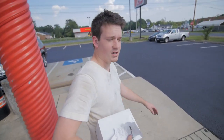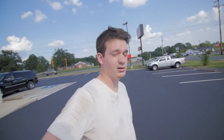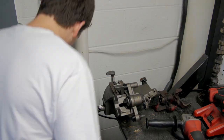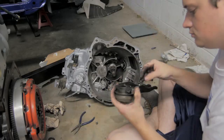Hey Ben, are you happy? Not happy that I just spent $100 — a very stock-looking part. So I swapped the brake pads over to the new brake caliper, mounted everything up and put it on the rear disc. I was going to bleed them out but I didn't have anyone to help me, so I had to move on to other things. We'll get back to that later.